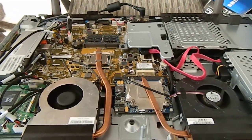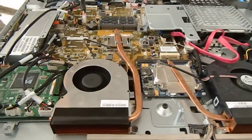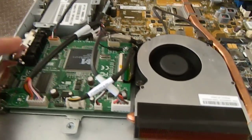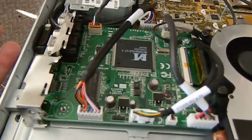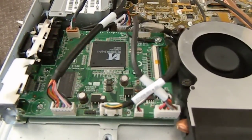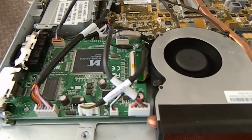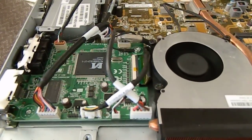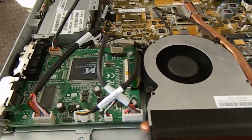The way I resolved this issue was to actually replace my HDMI card, which is this one over here on the side — that was causing an overheating and was basically making the screen shut down. I used an HDMI card off of eBay and I just replaced it today.